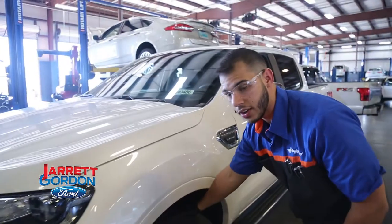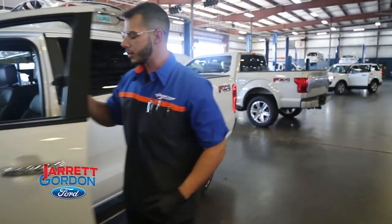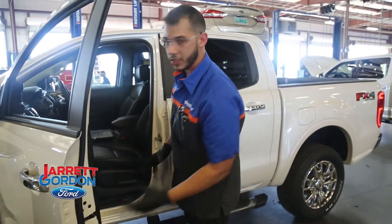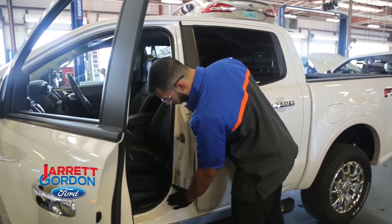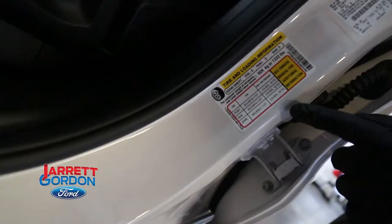After you verify that nothing is wrong with the tire, you can come over to the driver's side door, go ahead and open it up and there will be a sticker either on this side of the door or on the door itself. There will be a sticker that will tell you your tire pressure. This is a 2019 Ford Ranger — in this case it's right here on the side of the vehicle and this one is rated at 30 PSI for your tires.